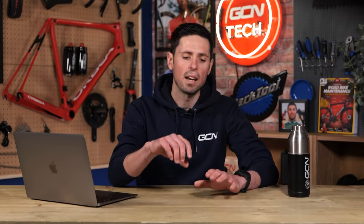The widest tires that are going to be able to fit into your bike — there is no set way of telling this, there isn't a standard measurement. The thing you'll also find is that depending on what size or brand of tire you use, they do measure all very slightly differently. A 28-millimeter wide tire in one brand might be slightly narrower or wider than another brand. Also, what you need to take into account is that as you start to choose slightly wider tires, the overall circumference of the wheel is going to increase as well.